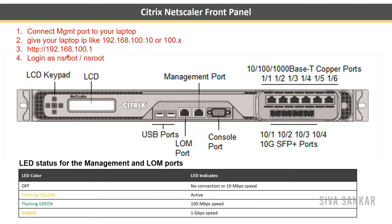When the NetScaler is shipped from Citrix it is configured with the default IP 192.168.100.1. If you want to know which firmware and IP, just click the button on the front panel and wait a few seconds — you will see the NetScaler IP. To connect initially, plug your laptop into the management port (port 0/1) and assign your laptop an IP in the 192.168.100.x series, such as 192.168.100.10.